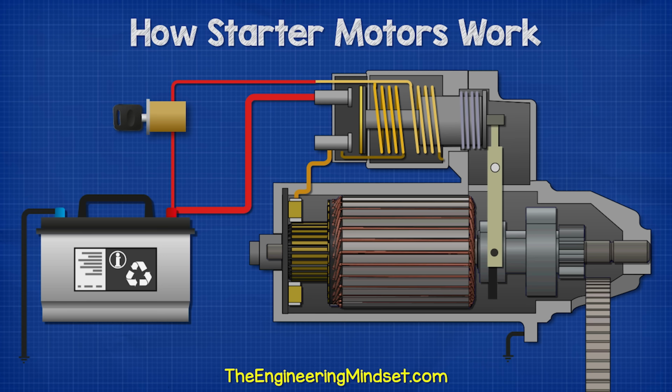When the ignition key is turned, it causes a small current of electricity to flow into the solenoid coil. The solenoid is usually made of two coils, known as the pull-in coil and the hold-in coil. The end of the hold-in coil connects to the casing of the starter motor, so the current returns to the battery via the frame of the car.